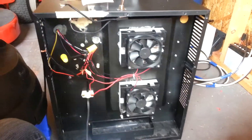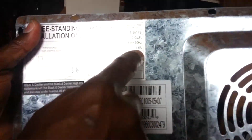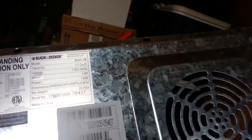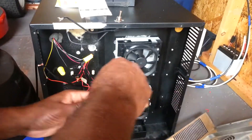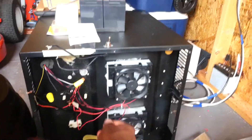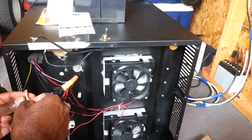This refrigerator, when it was AC powered — as you can look at the current draw — takes about 1.6 amps. So maybe a 3 amp fuse will work for this one. But I love fuses, guys. It's just a good practice to use fuses in your application.